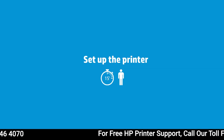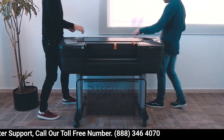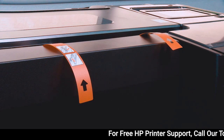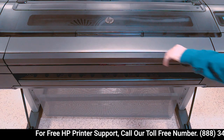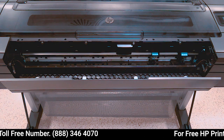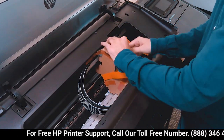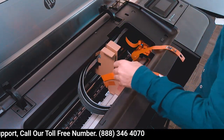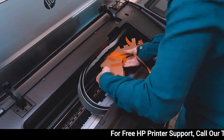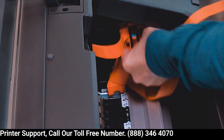Set up the printer. Remove the orange tape pieces from the product, except for the ones coming from inside the product. If you have a HP DesignJet Z6 or Z9 Plus with vertical trimmer, open the vertical trimmer cover and confirm that the modules are located on the bar. Open the top window cover — you will see a cardboard support attached to the product with tape. Remove the tape, turn the cardboard support 90 degrees to the right, be careful to avoid hitting the belts, then carefully lift the cardboard support up and out of the product and discard it. Inside the right-hand side of the printer, remove the stopper and discard it.